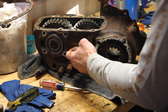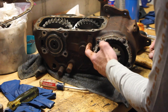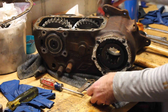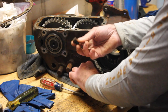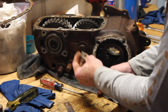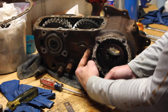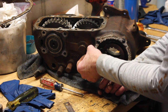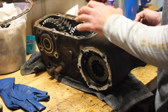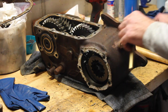First thing to remove the counter shaft is this bolt in the middle that has the identification plate on it - a half-inch head bolt. When you remove it you get three things: the bolt, your identification tag, and a locking washer that fits underneath the lip of the counter shaft that keeps it from rotating. I've been calling this thing the wrong component - this is not the counter shaft, this is the intermediate shaft.